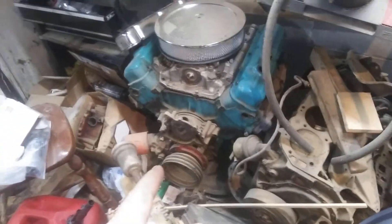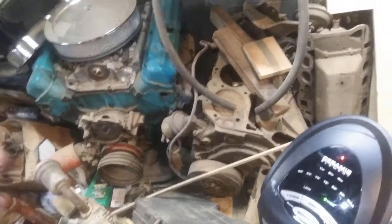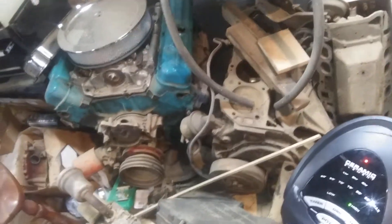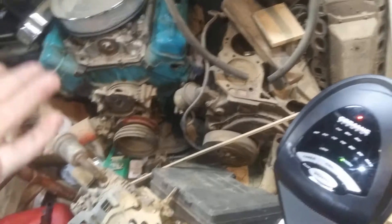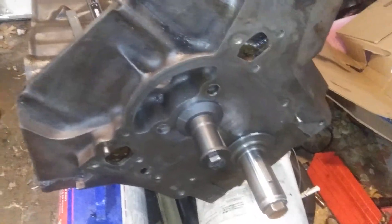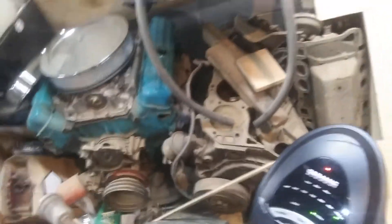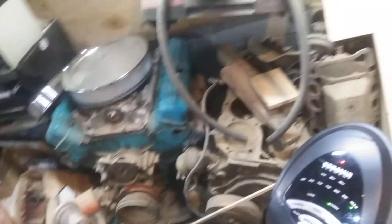This motor, when it was first built, I used the cheapest pistons I could possibly find, which were actually cheaper than the 3-liter V6 ones. Its compression, after I tore it apart after it blew up and figured everything out, was about 7.9 to 1 — which is basically what it was stock. This was a 76 engine, they were 8 to 1 anyway, but with the 30-over bore and the deep dish piston it was about 7.9 to 1. This had a Comp 268 cam in it, which was basically one or two levels above that mock-up cam. It sounded super choppy, and I was running it open headers for a while — it just sounded like it had 700 horsepower, but it way fucking didn't. It was probably about 250 at best. But that thing would haul ass up until about 4,500 RPM when it would just run out of breath.